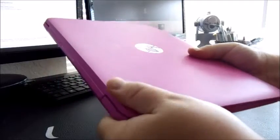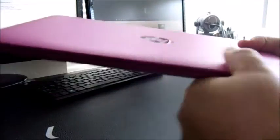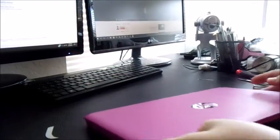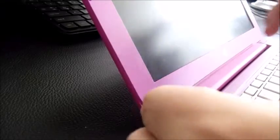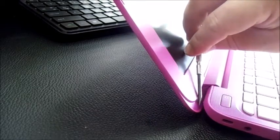Once the ribbon is in, fasten all the screws back, then pop the bezel back on. Close it like a book and go around pinching it to close any little gaps. For the adhesive end caps, line them up and use a slightly larger flathead to gently press them back down into place.